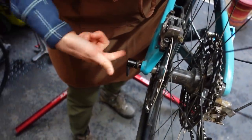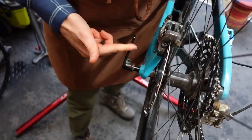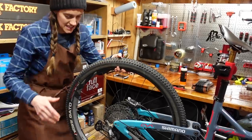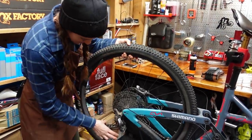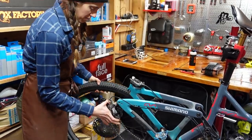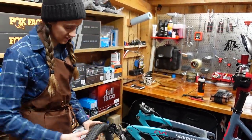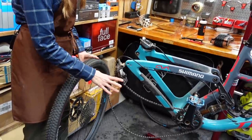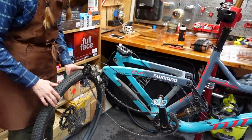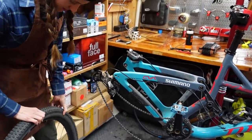You may have Allen key bolts here depending on your bike. I'm going to pull out the skewer, hold it like this, and then this is where the magic happens — you kind of pull the derailleur back and then boom. That was beautifully done. And it doesn't hurt your derailleur to do this, that's what it does when you ride. If you have a SRAM derailleur, you'll actually push it down and then lock it open — that's how their clutches work.